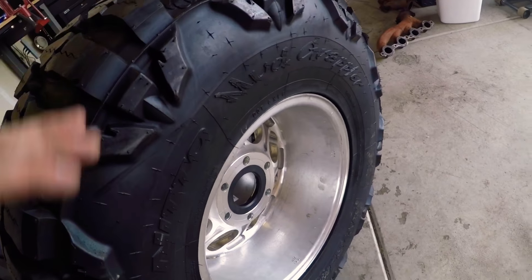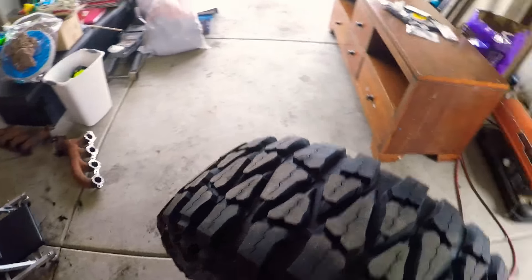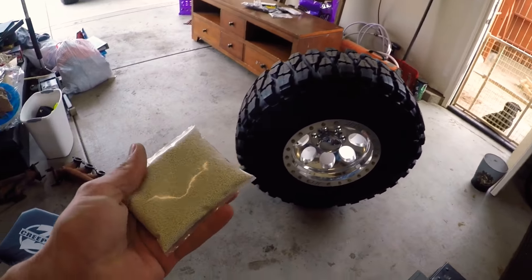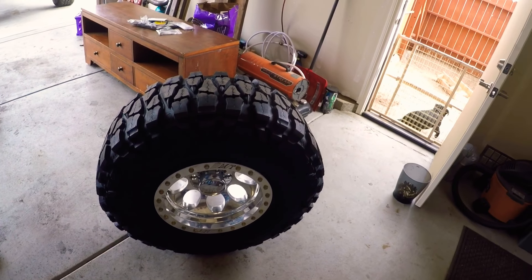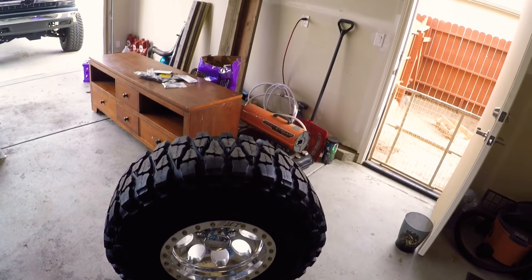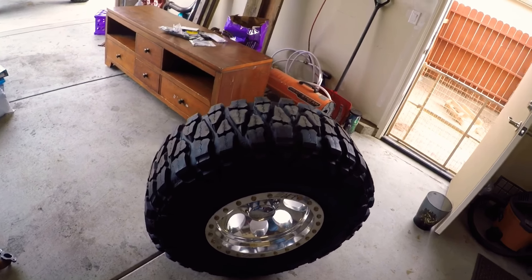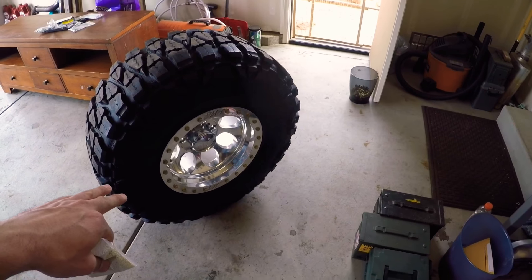It's a one-and-done solution — for the life of the tire it'll be balanced and you'll never have to worry about it. These cost about as much as getting a tire balanced anyway. I took this tire and wheel to the shop for mount-only service — twenty bucks — and off I went. Then I'll show you how to put the beads in by pulling the valve stem core out.